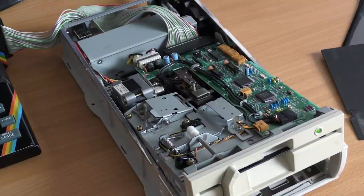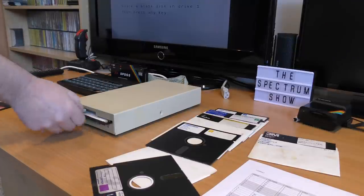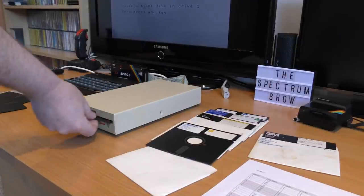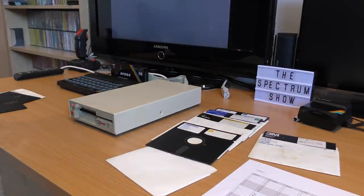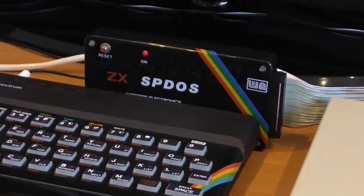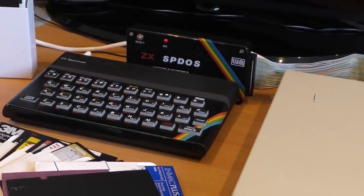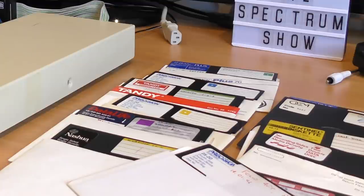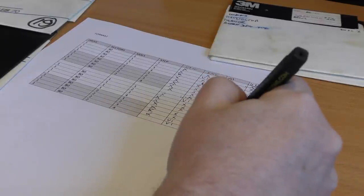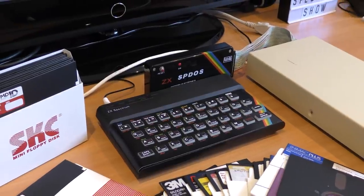In between all of this testing, I bought another drive that had been restored and was fully working — a BBC Micro drive, the exact drive recommended by Watford Electronics. Upon trying again, the boot disk loaded but the format failed. I checked the cable with a multimeter, everything seemed fine, and I tried numerous other format commands along with numerous other disks, and all of them failed. To be extra thorough, I bought a job lot of disks with varying manufacturers, densities, tracks and sides — and all of them failed. I also tried another external casing and another Spectrum, and still got the same error.